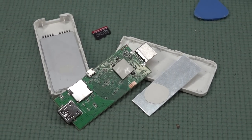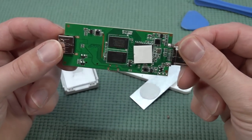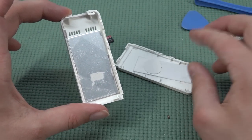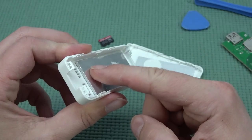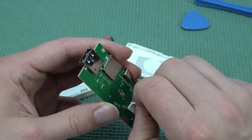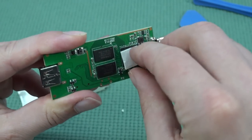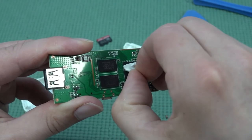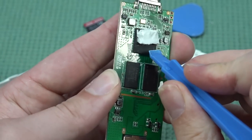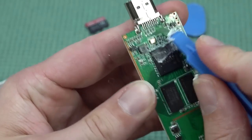Let's take a peek inside. I've seen a lot of game sticks over the last few months of doing these reviews. One thing I've noticed is they use different methods of cooling — passive cooling being the most popular. In here there are two metal plates: a very thin one at the top and a very thick one. It doesn't transfer a lot of heat but maybe enough to cool the chip down. There's no active cooling whatsoever — just some thermal pads in place. The thermal pad sits right at the back where the chip is, and removing it reveals a different substance, more like double-sided tape than thermal paste. I need to apply proper thermal paste myself.